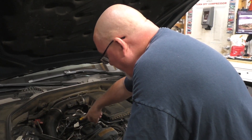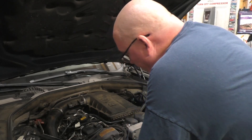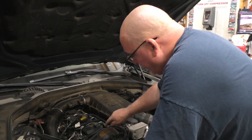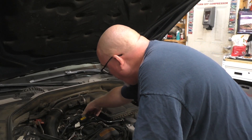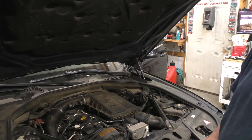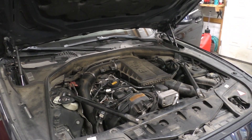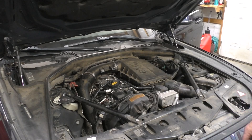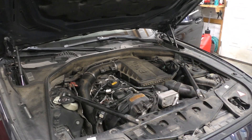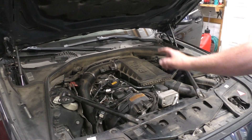This right here is what I think is the culprit. Normally we'd have to undo all these high pressure fuel lines — and I believe they have to be replaced — on top of replacing the whole entire valve cover. But I'm not going to replace any of that, because some channel on YouTube has used a hot air gun to take this apart or loosen it up. I want to prove that there is actually something wrong with the diaphragm. If that's not the case, then there's likely a problem with a crankcase seal, and that would be a much more expensive repair. This part is $25 on Amazon.